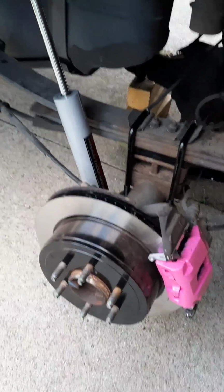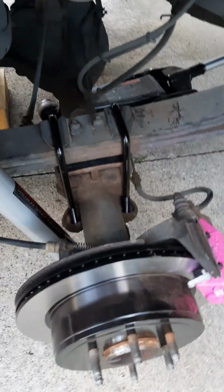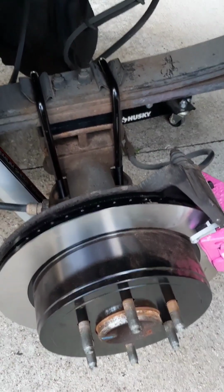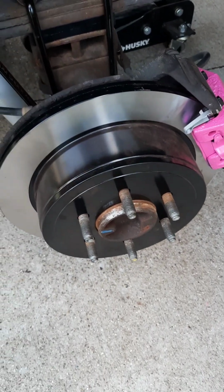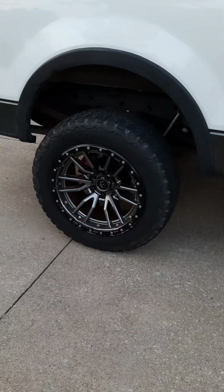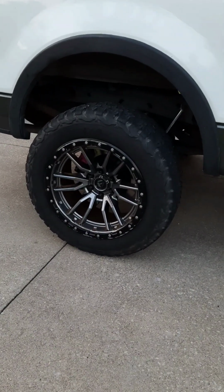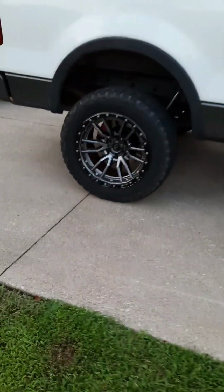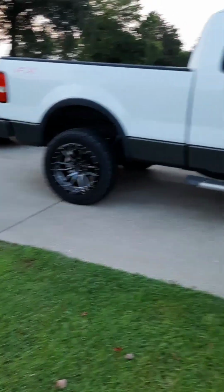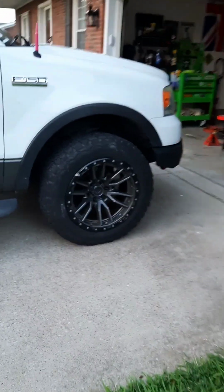Alright, so we got one side done, got the new Rough Country shock on and the new U-bolts and the block, new rotors and brakes. I gotta do the other side and we'll be done with the back. Well, we are done with the back. Raised it up about 3 inches, so it looks pretty good. Now in the next video we're gonna do the front, which is probably a little more involved.